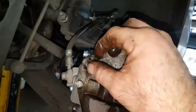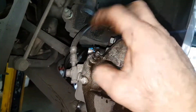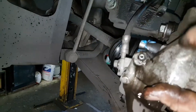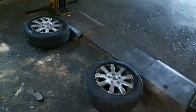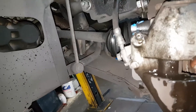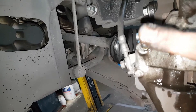You can see just from taking that out there's a little air bubble. With air, you don't want to open it all the way - you want to monitor air bubbles. The less that's open here, the more you can see. If you have doubts, just leave it for three minutes and let it go that way. Always top up the master before you begin, or suck it out, refill it and overfill it before you begin. If you can't open this with a proper tool, then don't do it.